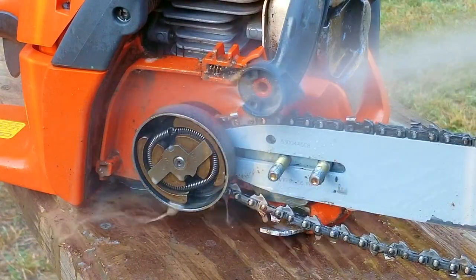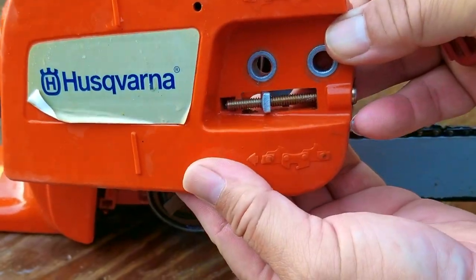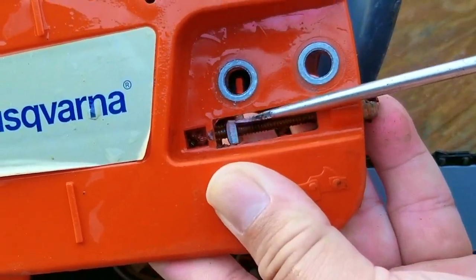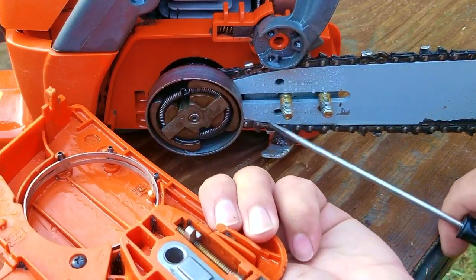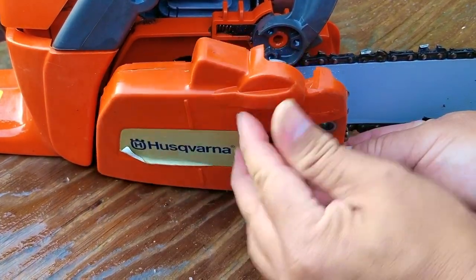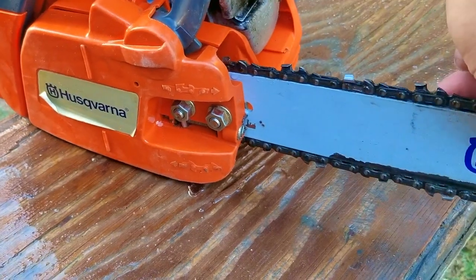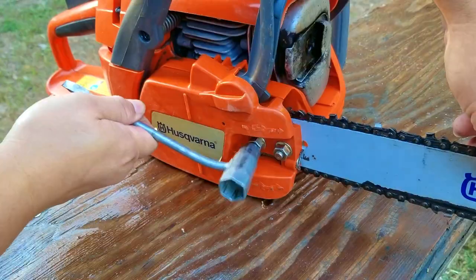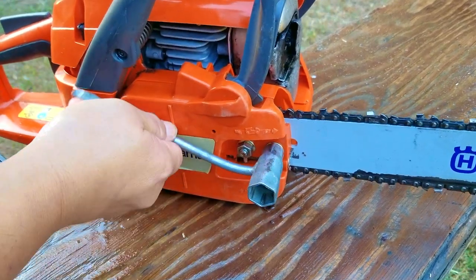After removing the cover I'm absolutely shocked by how clean it is in here. I think this saw was used to cut up a limb or two and then put away never to be seen again — the lack of oil and sawdust under the cover and the overall condition of the body support that theory. There's nothing wrong with that; it's actually nice to see someone buy a good brand for a small job. The bar and chain are in really good condition and I do think the saw only has a few hours on it. An easier way to confirm would have been to inspect the teeth on the clutch drum, but unfortunately I didn't do that.